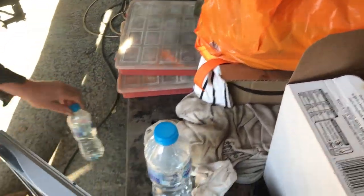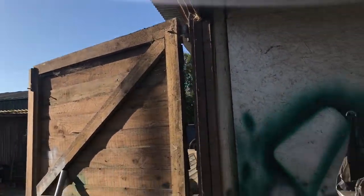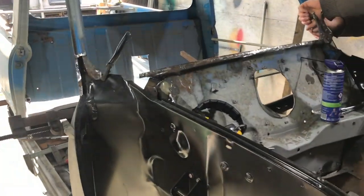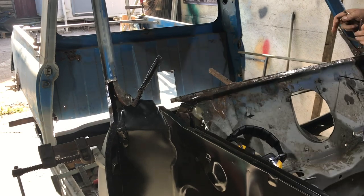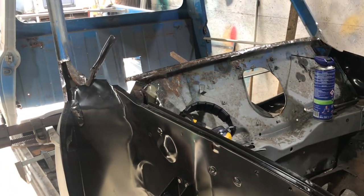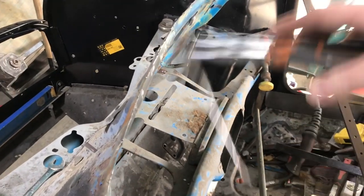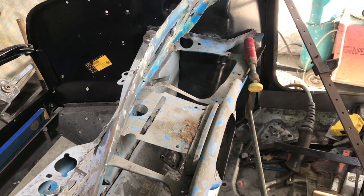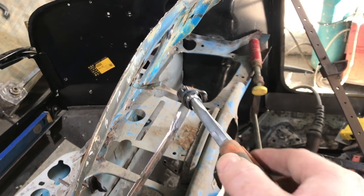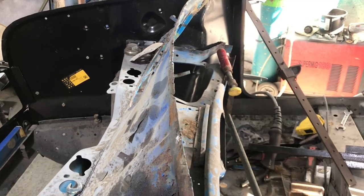Take that clamp off and try the stuff - cut the bulk of it off and then just went along unpicking the spot welds. Just needs a bit of dressing now. A lot of it rolled off because it was only half spot welded. Just caught on the edge - dress it up, try the new one.